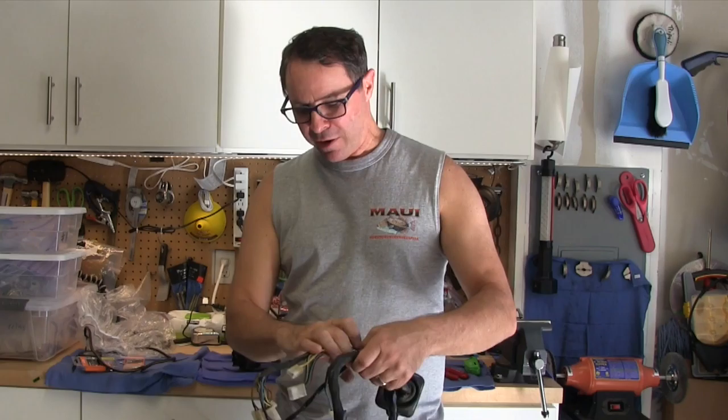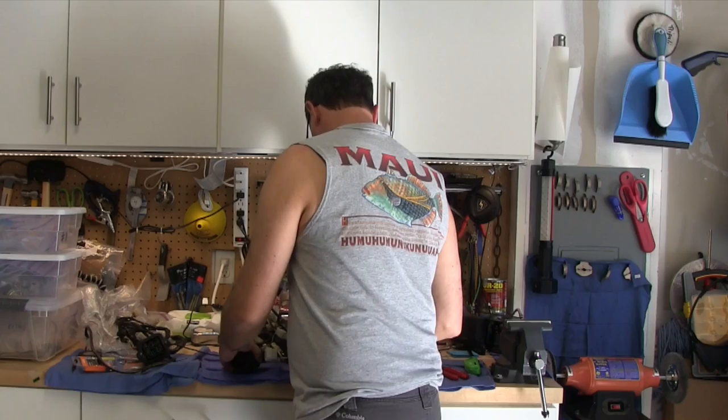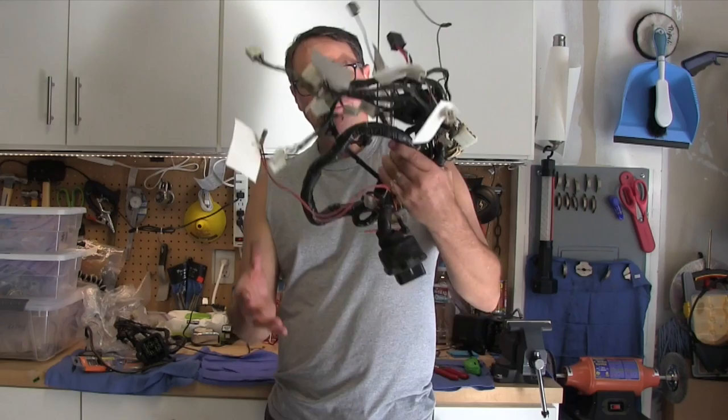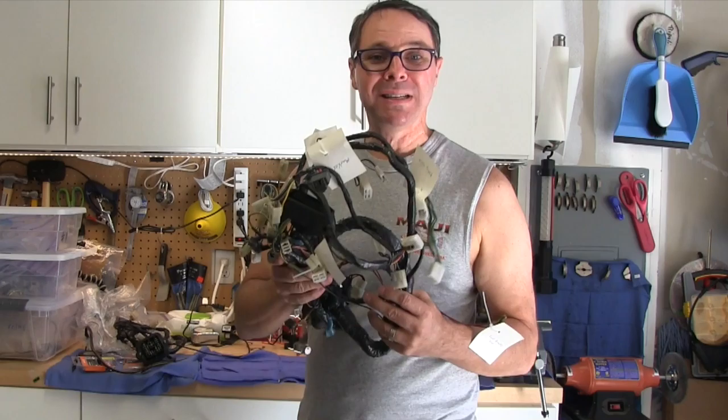I believe that concludes my work on wiring looms. With the fixing of the ground cable on the right-side loom and the repairs to the left-side main loom — most notably the horn wire that was missing — and the left-side sub loom getting the eyelet that goes to the alternator, with those repairs made we're ready to put the wiring harnesses back in the car. That's actually big because there are about half a dozen parts ready to go back into the engine bay that need the wiring loom in first, to make sure it's out of the way and everything can be easily gotten to. So back in the engine bay we go — progress happening.